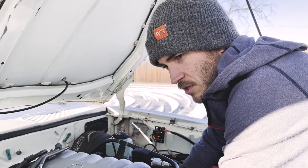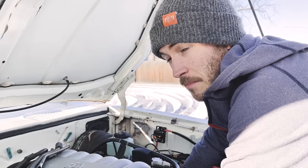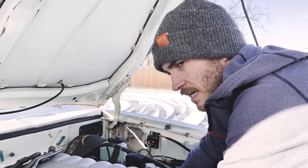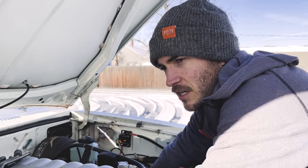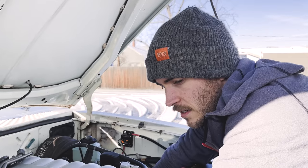There's just a couple things that are holding us up. One being, I think we have the wrong hubs on there, so we don't have four-wheel drive, which is the main thing that's holding us up. The other is, I may have set the caster incorrectly, or it may have changed when we fully loaded the truck up, but the steering is very darty when there's a kind of a crown in the road and it kind of just shoots around a little bit.